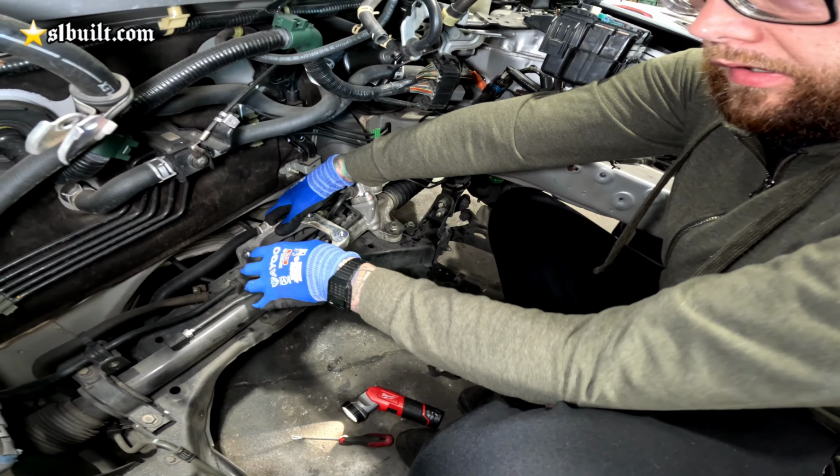He can show you. I put a thing on here, the cover plate for it. This isn't staying all-wheel drive, right? It's only going to be front wheel, so we could just put a cover plate for now. And then gusset this, reinforce the front of the mount up there like we talked about. Weld a plate off of here that's going to come up in an L, and then gusset that.